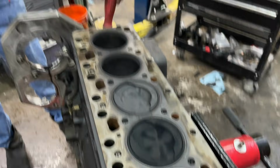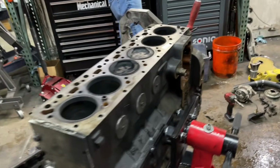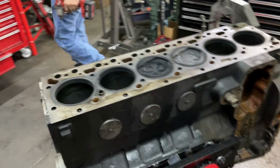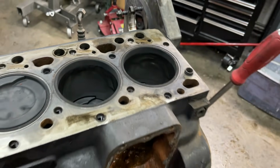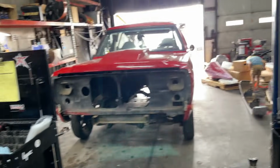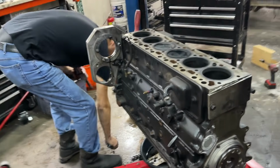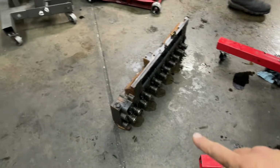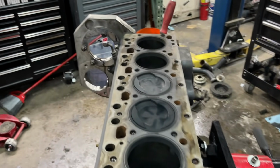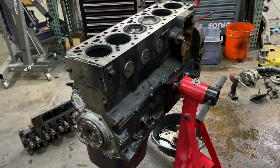That might also be why it was so down on power. Man, it just really, really sucks to see. And guys, the reason why we're leaving out the place that built this is that it does you no good. Just know what you're buying. Try to check it. Luckily for Reed's dad, he didn't pay a ton of money for this, but there's no business a 13 mil pump should have been on. Stock valve springs, stock push rods, stock rods, and forged pistons. This really, really sucks to see.